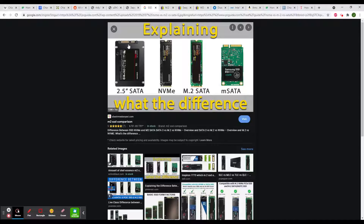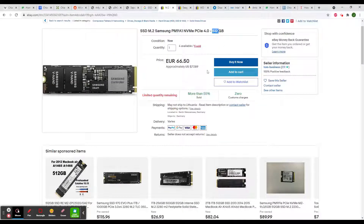You need to carefully choose your SSD disk because you need fast SSD interface speed, since the SSD disk will be used 100% of the time. I don't recommend SATA connections — I recommend M.2 or other fast PCIe interface SSD disks. You will need at least a 500GB SSD disk.